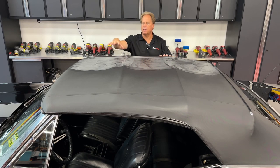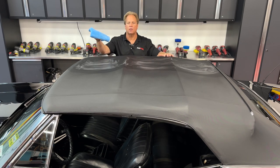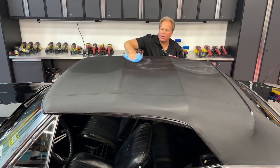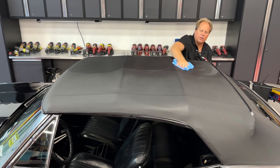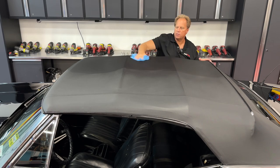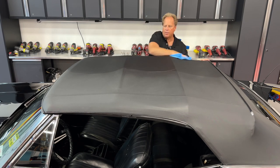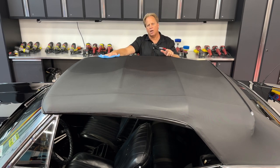We'll let this sit and penetrate for about 45 seconds to a minute, then we'll wipe off the extra and check out the before and after difference. After allowing the vinyl protection to penetrate and soak into the vinyl, go ahead and use a clean microfiber towel and just wipe off any excess. Besides adding UV protection and waterproofing the top to protect it from rain, sun, and all the other elements, it makes the top look beautiful. This is the finishing touch — we did all the paint correction and now we're finally at the very last step: putting on the protection for the vinyl top. That looks beautiful! You can get all rag top products at autoforge.net, and if you like this video, subscribe and share with your friends.